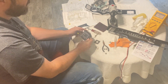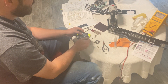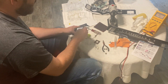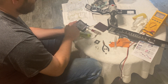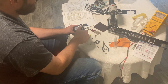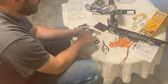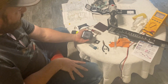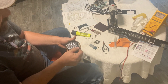I took the hands off — they come off fairly easy, sitting on three different size pegs. I'm just working with it to try to get the air bubbles out using the squeegee and my fingers, but you've got air bubbles and liquid in there from the application spray. They say you can use a hair dryer to speed up the curing. Probably the least amount of liquid you can put on there the better, because liquid can get trapped under there. That's what the final product looks like — and the edges will be covered by the speedometer bezel, so that won't be a problem.